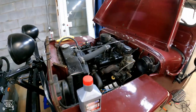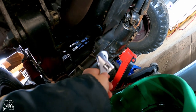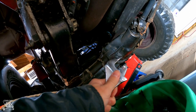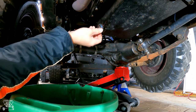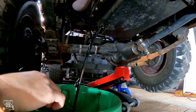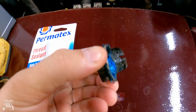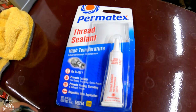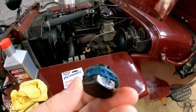Let's go down to the bottom and start draining it. When you get under the engine, the L134 drain plug is right here. I believe it's an inch and an eighth, which I don't have, so I'm going to use my crescent wrench to take that out. While that's draining, I want to show you this plug — it's got some sealing on it. I'm going to clean it off and put some Permatex thread sealant on it to ensure it won't leak when I put it back in.